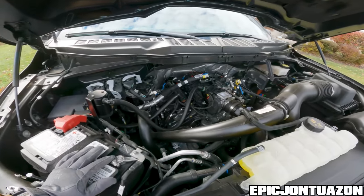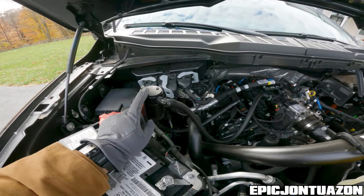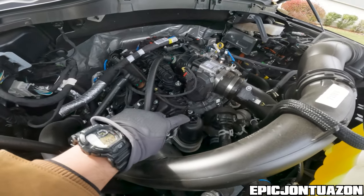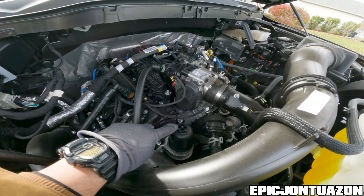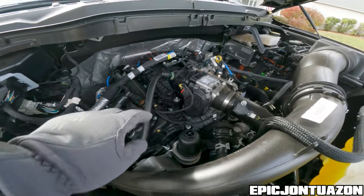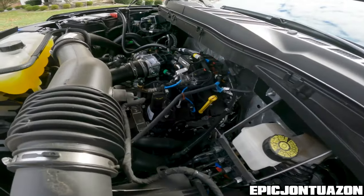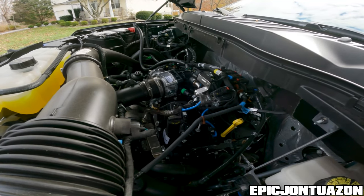So I have the 2.7 liter model. We have here an oil catch can which I'm going to empty out in a second. But just for logistics, this is the oil filter location, so you're going to need a 27 millimeter socket head to remove that. Also, the fill is right on the driver's side right over there, and it tells you what kind of oil you'll need in case you don't know — 5W30.